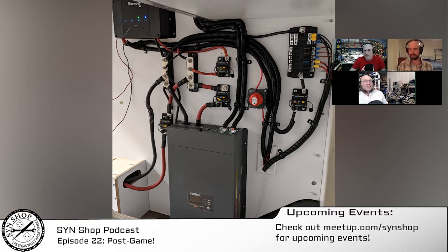That red knob is not an emergency button — it just depends how big the fire is. The electrical part is scary for a lot of people, and it should be scary — that's what's going to burn down your van when you're out on a hike. If you didn't fuse anything and something goes wrong, you've got a 200-amp arc welder in the back of your van going crazy. Just fuse everything — if in doubt, fuse it. Extra fuses and breakers won't hurt anything.